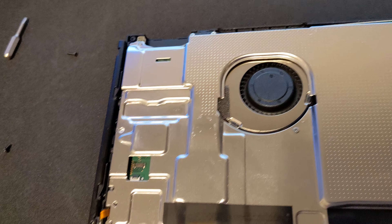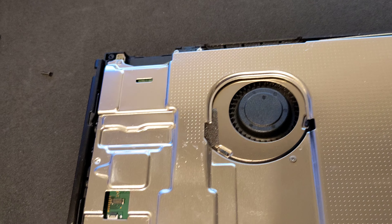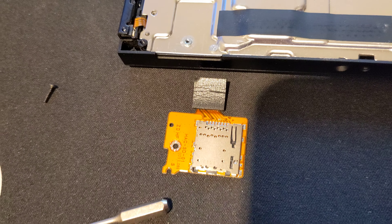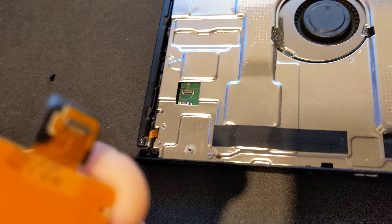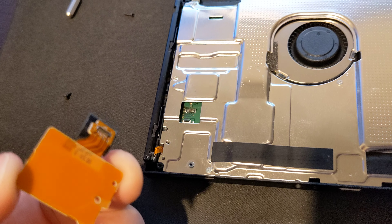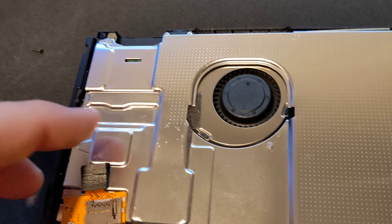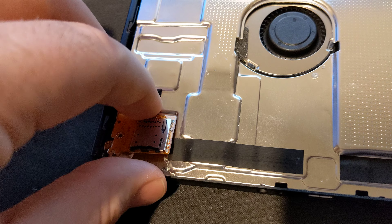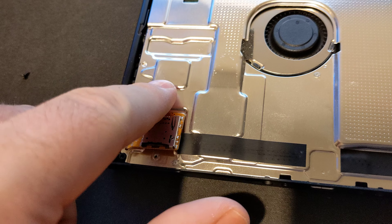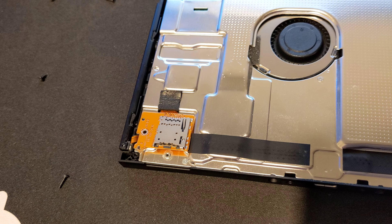This is the connector for the little SD card reader. Apparently this little connector pops loose with enough moving around, so I took it apart — took off the back panel to get to it. You can just seat it back in there by pushing it back in. My little foam pad was depressed too, so I think I might add something here once I'm done setting this back up.